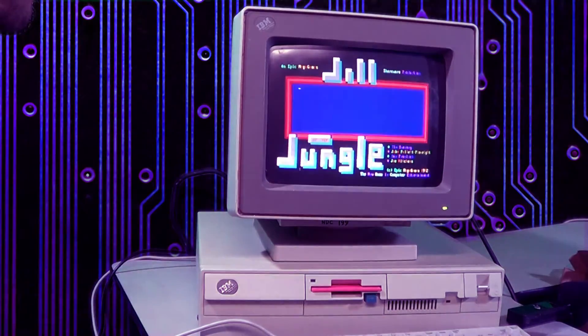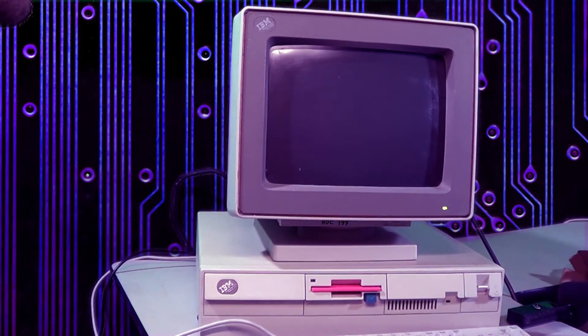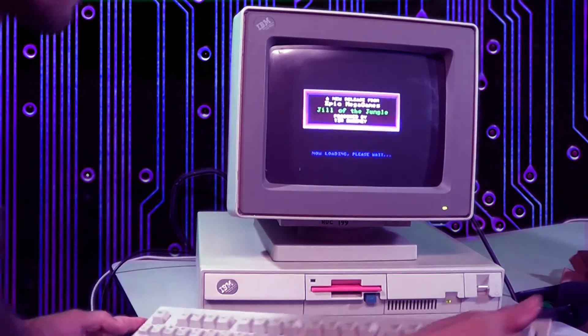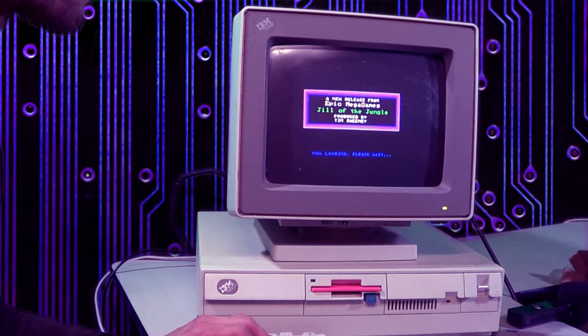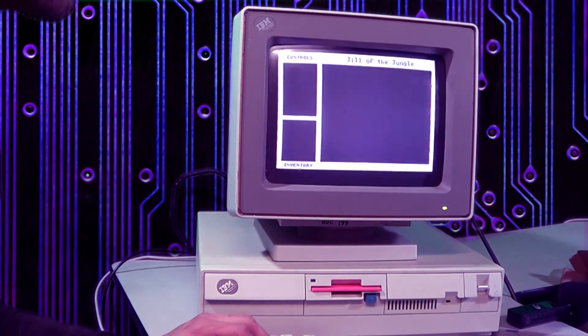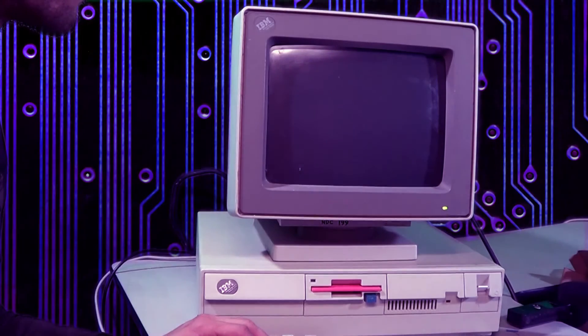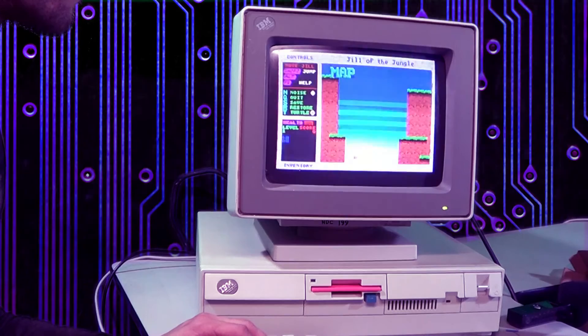Now I'm just going to do my little Jill of the Jungle test. This is kind of strange — I honestly thought this game would play a bit better on this hardware, but I'll let you guys be the judge. I also wanted to mention that the 3.5-inch hard drive is very loud. I've found this to be quite common with 3.5-inch MFM drives — I'm not sure if they use a thinner material, but they seem to have a much louder noise than many of my 5.25-inch drives. Just in case you're wondering, this drive is actually a lot louder when I first pulled it out of that box — it's quietened down quite a bit and doesn't get anywhere near as hot now, which was fantastic.